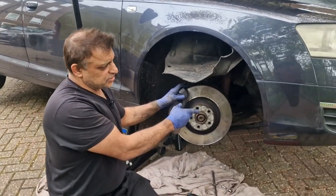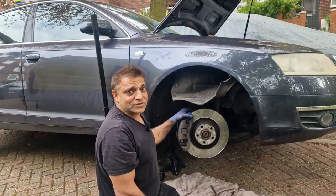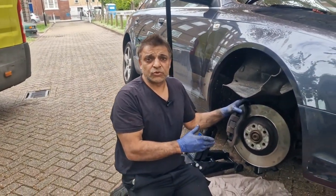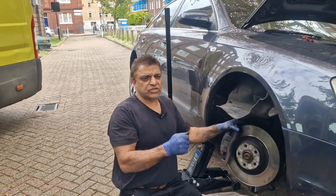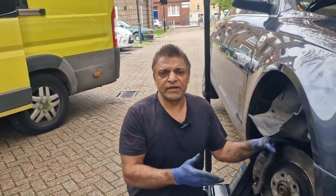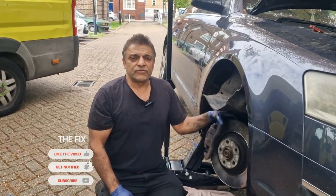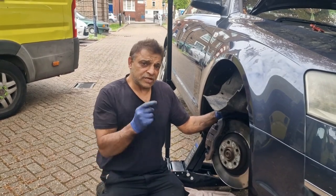Now that we've finished putting back the plates and the starter motor has been fitted, I wouldn't like to do one of these again anytime soon because it was a mission — there was a big lack of space and getting to stuff was very difficult. Hopefully that was the fault, because the owner said sometimes the starter would click and it wouldn't start. If it's not the starter, we'll find out later if it's the relay, the wiring, or the ignition. For now it's done — I'm just going to put back the wheel arch and the undercarriage. If you enjoyed the video and haven't already, please subscribe to the channel and click the bell icon so you get all the future videos of The Fix. And remember — don't jinx it, fix it!